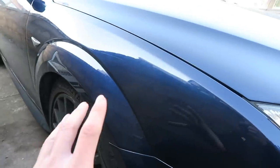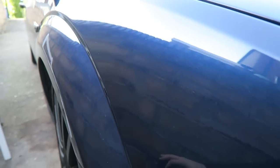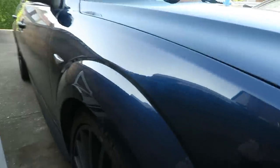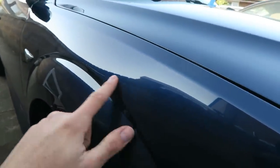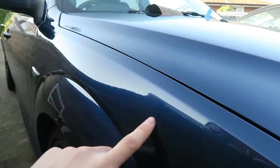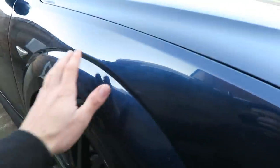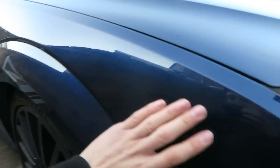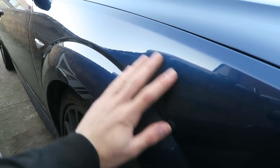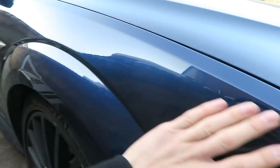After using the Super Resin Polish with a polishing pad, you've still got that lovely sheen to it. The scratch now sort of just looks like a scratch you'd get if you drove past a bush — it doesn't look like a key scratch anymore. It looks a lot better in person than it does on camera. The panel is now absolutely silky smooth now that it's been wet sanded. A lot of learning has gone into this — I've learned a lot of errors, but I can only do a better job next time.